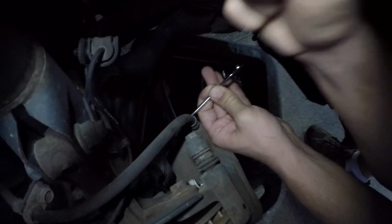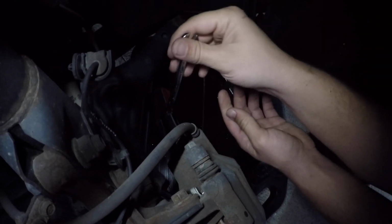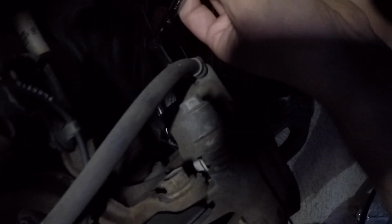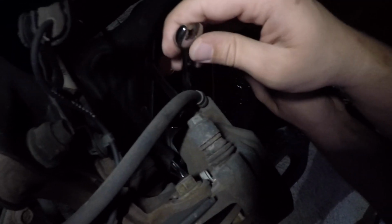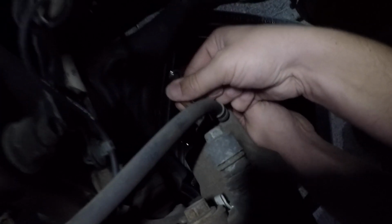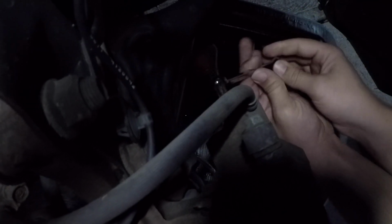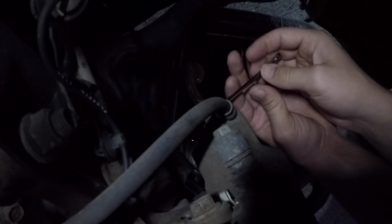Now, nope, there we go. Now just be really gentle. See, you can't lose it. Make sure that's still fully seated. Okay, make sure it's seated. And same thing, just wiggle it off. Just wiggle to open the bleeder valve. Okay, and we have bubbles. We have bubbles. All right. Let's keep going.